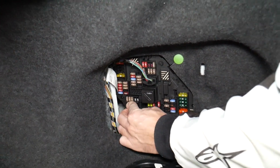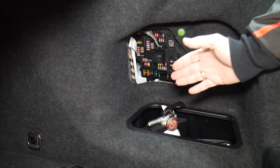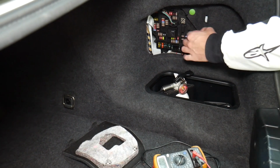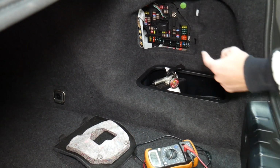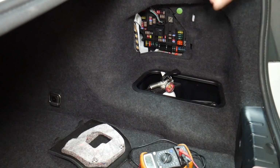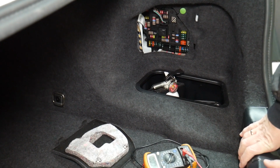Another thing, always test your relays. They're a little bit harder to test, but if you want to see how to test fuses and relays, we will put a link in the description of the video below. We've seen so many customers that think they have a good fuse, they put it back in, they waste their money on parts and diagnostics that they practically do not need. So check out the link in the description below for how to test the fuse and how to test the relay as well.